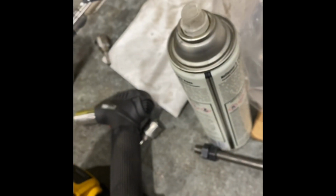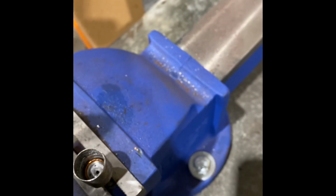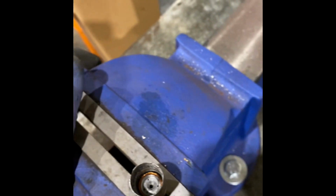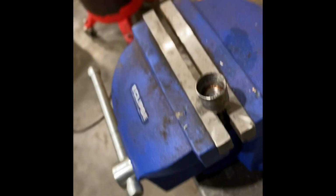And at least all my injectors, they're missing the little seat and the O-ring and the snap ring that are usually here. So make sure you take some needle nose, go pull those out. So there'll be this and the little snap ring. You might need a puller for those as well. I think I'm gonna leave mine in, take them off the new one, and then let it sit, because those are corroded in so good. The only thing they're really there for is kind of to help hold them down, but you got the fuel rail sitting on top that pushes them down.